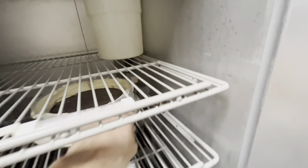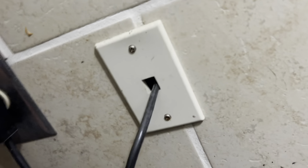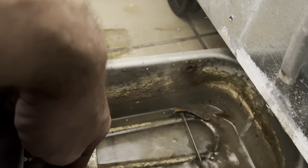Not leaking inside — beautiful. So the water was coming here, and this was the low spot — it was dripping down and making all this mess. We're going to knock that off. She is draining now, you can see. And for those who have never seen this, there's a float in here — it's plugged into its own outlet. When the water hits a certain level the float goes up and the heater energizes. Let's see if the heater still works — oh yeah! The heater energizes and starts boiling off the water, and you can already see the steam.